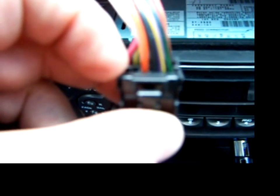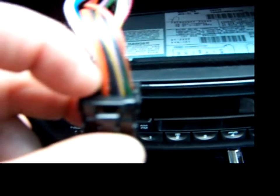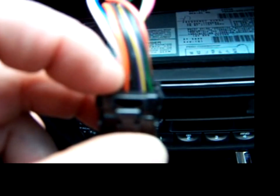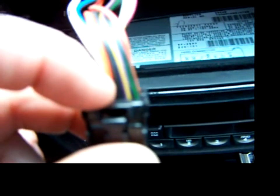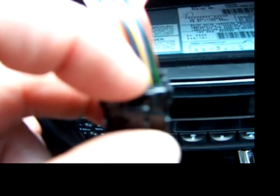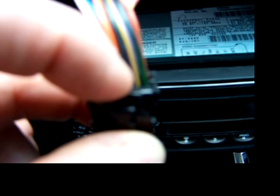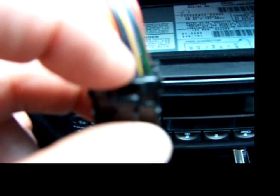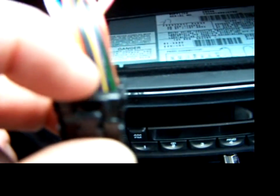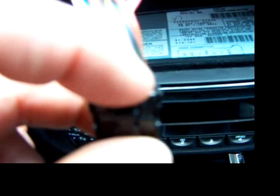These are some spots, 6 here. 5 is next. The orange is number 4. That goes to the panel lamps. The next one is black, number 3. That's ground. Then yellow, actually it looks violet with a yellow stripe, and that goes to the PCI. And then the black with light green stripe, that's another ground.